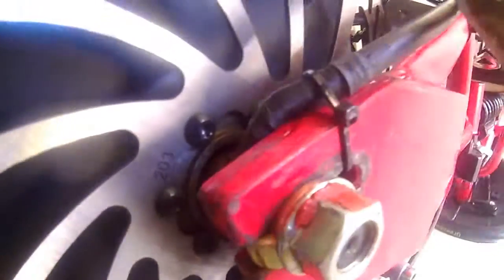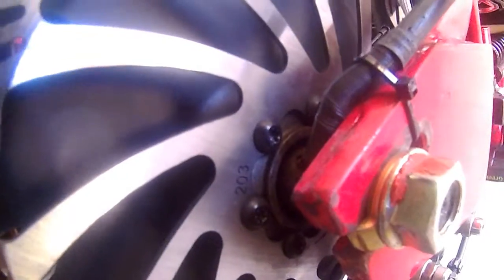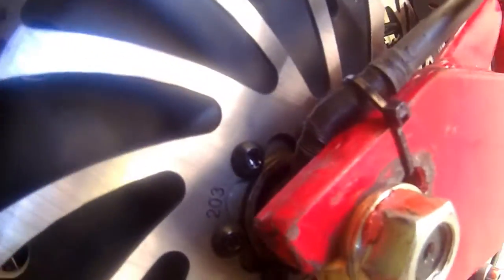After the bike is flipped, we need to take some tools. So what do we need to take this wheel off? We need a 21mm wrench, cutter for the zip ties, 5mm hex key. And we're gonna need to open the rotor as well with — whatever you call it in English — star key, we call it in Hebrew. And we need another 4mm L-key.